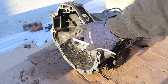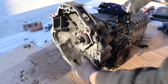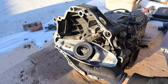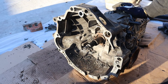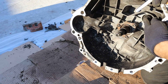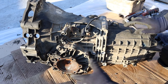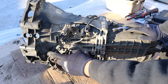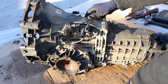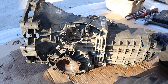Taking a quick look around this transmission, you can see inside the bell housing there's a lot of clutch material — that's where your clutch lives. You can see the fork over here which is going to be activating the clutch. Right here is the throw-out bearing, which can make noise when it wears out. Here we've got the input shaft, and looking up inside you can see the piston that's going to be pushing out that fork against the pressure plate. Coming around to the front, you've got the flange for the driver's side axle, your output speed sensor, the plug that leads to your input speed sensor, and the hookups for the cylinder that activates and deactivates the clutch.